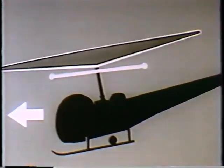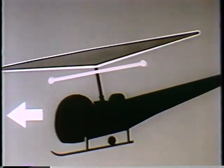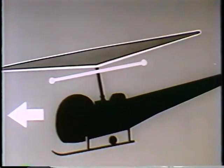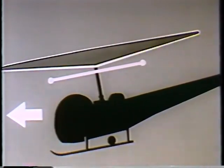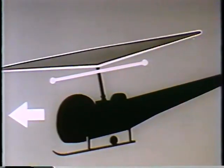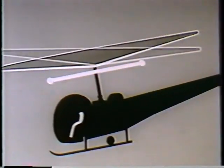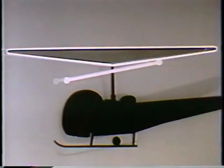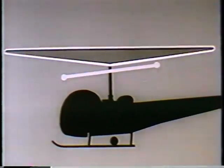Since the bar has delayed 29% of the cyclic control, it would be 15 to 20 seconds before the pilot got a full 100% response to his applied control movement. And the same delay would occur each time the pilot moved the cyclic control. Obviously, the controls would be much too sluggish.